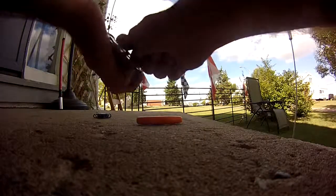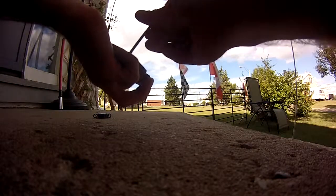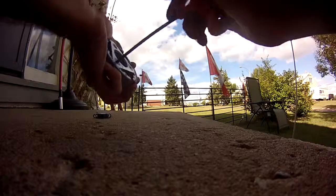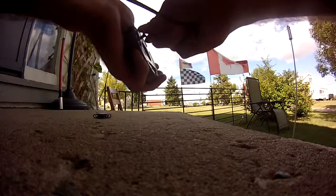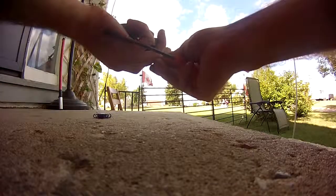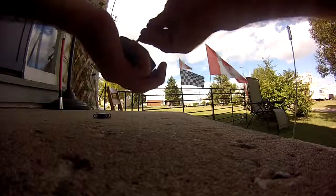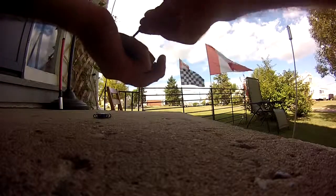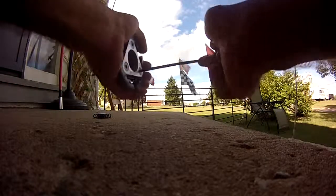You don't want these binding up and one shoe coming out, the other not. In my eyes, that's probably where a lot of the shudder is coming from. Brian's been changing springs in a Stalker, and the Stalker's fine. First gear seems to work fine, and my shoes are loose there, so I've got this tightened down.